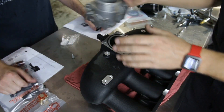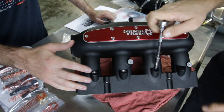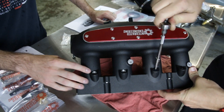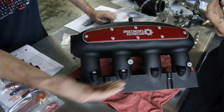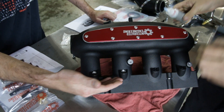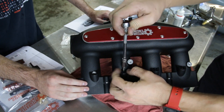Now we're going to put our throttle body in place. Now we're installing our plugs in the ports here for water-meth or, as Cody mentioned earlier, you can put nitrous in there. He's actually using blue Loctite on those for two purposes: one so that they don't back out — obviously for strength — but also for a seal, to make sure you don't have any intake leaks, because we are not going to be using water-meth at this time.